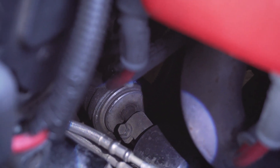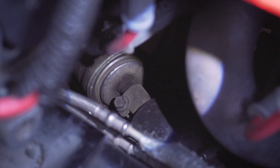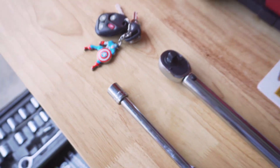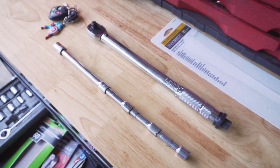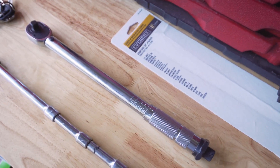I'm going to set the camera down and grab some tools. Just to demonstrate this for you guys, I've got my sister in the car and she's going to move the steering wheel. You can see it's got some play there on the shaft. The bolt that's actually on there is a 13 millimeter. So we've got a 13 millimeter socket, three 3-inch extensions, and one 6-inch extension — working with what I've got. And we've got a torque wrench set to 25 foot-pounds, as I previously mentioned.